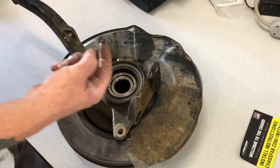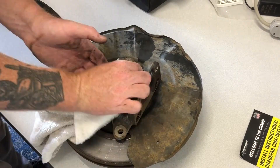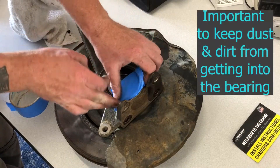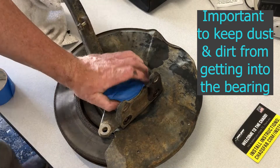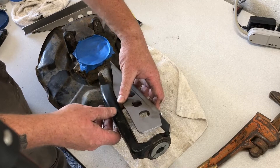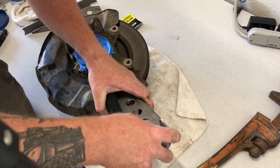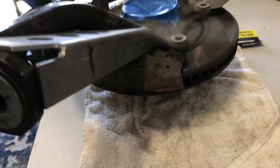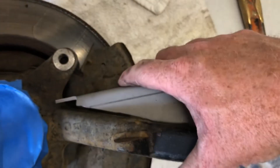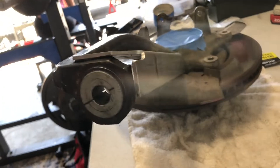Now I'm just going to clean out all the gunk — looks like I found an almond in there or something. We're just going to use some painter's tape to keep anything from getting into that bearing. Here I'm just working on a test fit. There's actually quite a bit of footage of me doing it wrong. Even looking at the picture, it was hard to line up the right way. Now's a perfect time to run a Sharpie or a paint marker around the spindle gusset, just so you know where you have to grind.